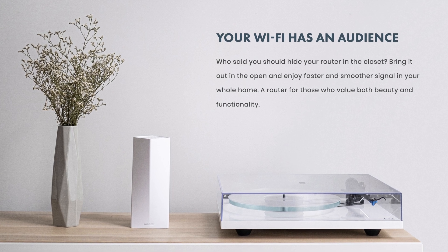So, what is the correct solution? Where do you put the router? There was a time when everyone kept hiding their routers — and no wonder, most of them looked bad. But nowadays you can get some stylish stuff like the elegant Chateau or the futuristic Audience. So bring it out in the open, somewhere in the central room. Routers usually broadcast the signal all around, even if the antennas look pointy to one side. So putting it in the corner isn't too efficient. Don't put it on the floor either — try a table instead, or a nice high shelf.